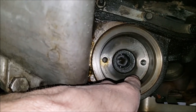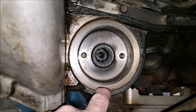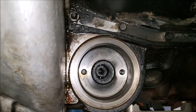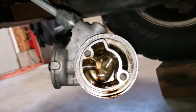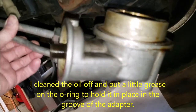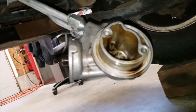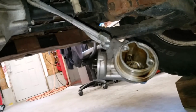Make sure you get all that old gasket out. The one that was in here was hard as a rock — like a hard piece of plastic. If it started out as an o-ring, it was completely flat and brittle like a piece of plastic. I cleaned this thing all up so I can put it back up in there. The oil filter goes on right here.